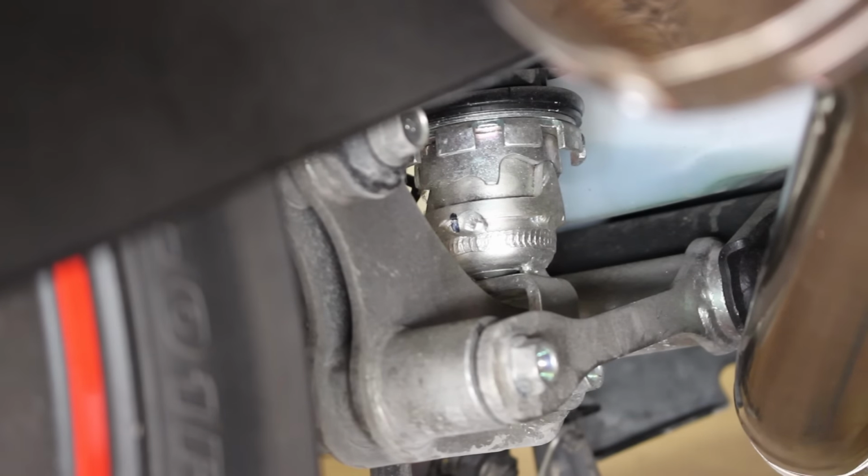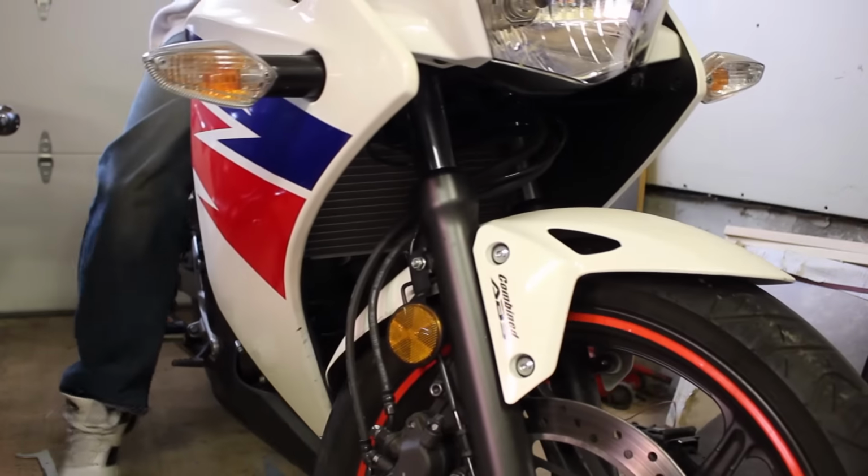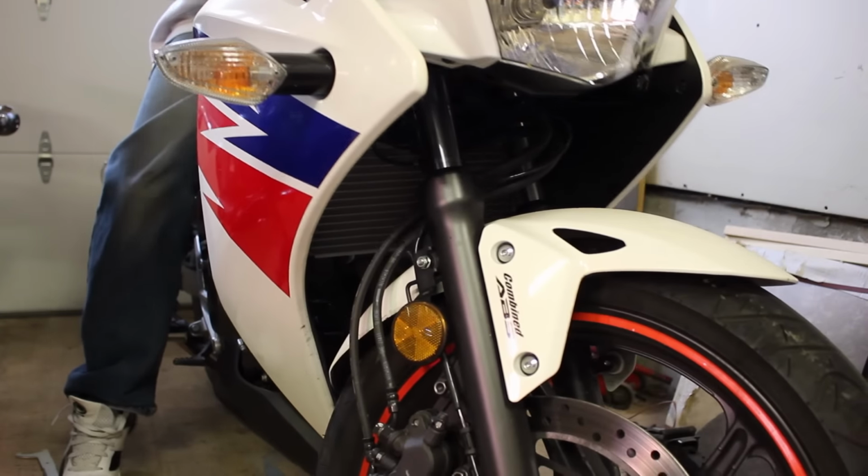So why would you want to change the suspension settings in the first place? Well, to keep it simple, a softer setting increases riding comfort so that your spine absorbs less of the energy transfer from bumps, but takes less additional load for the suspension to bottom out. On the other hand, a stiffer setting will be capable of taking on a heavier load before the suspension bottoms out, but will provide a less comfortable ride.